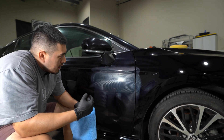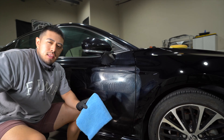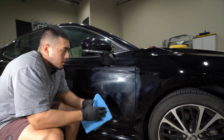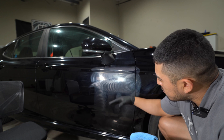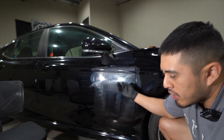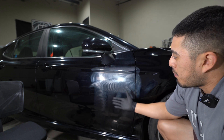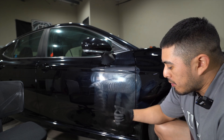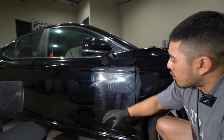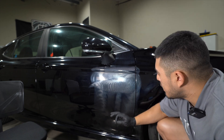What you can do is look through your light source to inspect your paintwork. Over time, before you start wiping it down, try to look through the light. You want to work the product in enough to where it's almost translucent and you can see through the compound or polish. You can actually see if you removed the defects, because maybe you just need one more light pass — instead of wiping down and loading the pad again, you might just put the pad back on, spray a little water to reactivate it, or add one small dot and start correcting again. Looking through the compound here, I can tell that it's a great improvement.